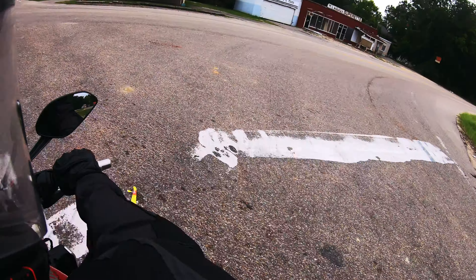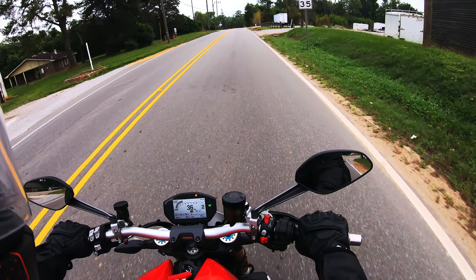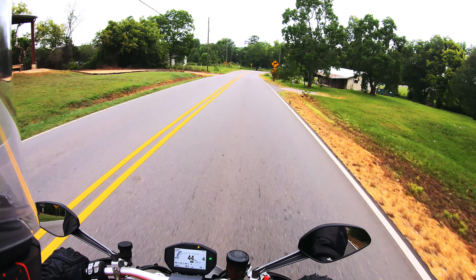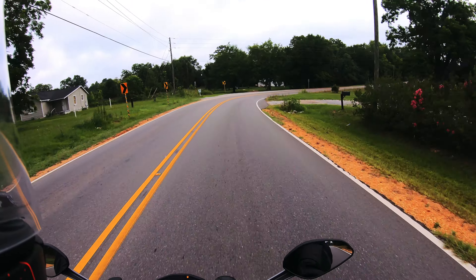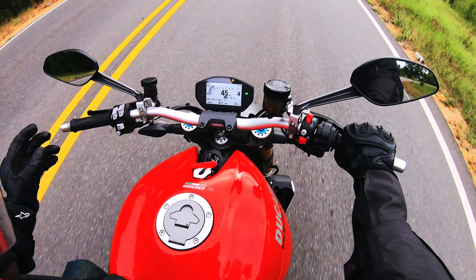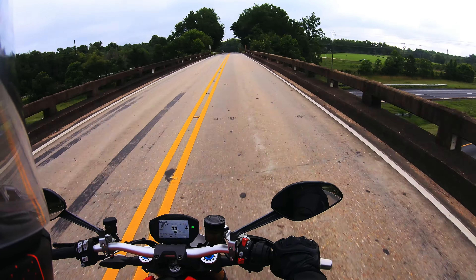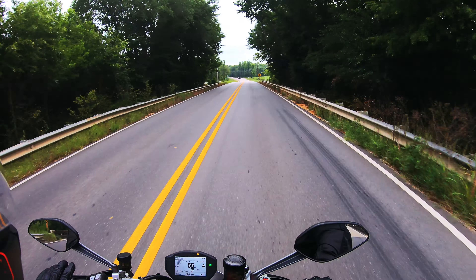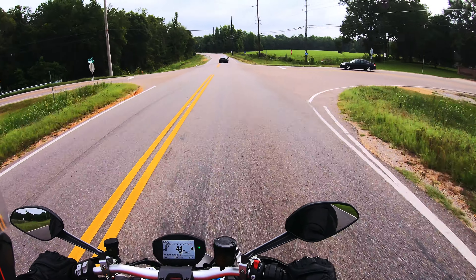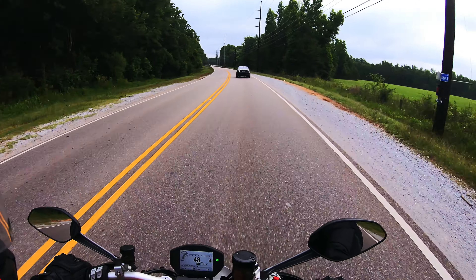With my weight, that's my tire pressure until I drop some weight, and it seems to be working. I was getting premature tire wear — I only got 2,100 miles out of my original rear tire. The original Pirellis are a sticky tire and don't last long, but it flat-spotted and wore unevenly and choppily. A lot of that was due to incorrect tire pressure, and also contributed to my suspension being out of sorts during that period of time.